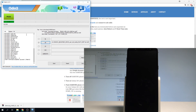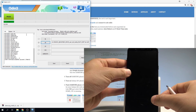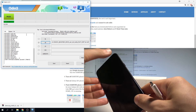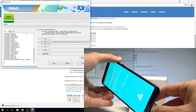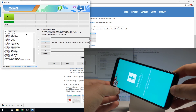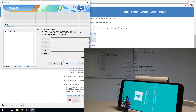The hard reset is done. Press the power key and switch off the device. Prepare the micro USB cable again and enter download mode: hold volume down and volume up together, connect the phone via micro USB cable, keep holding both keys, release when the warning pops up, and press volume up to confirm. You are now in download mode — go back to Odin and tap Reset.